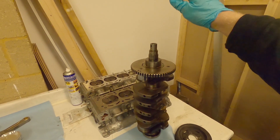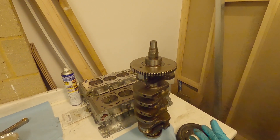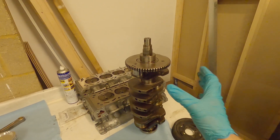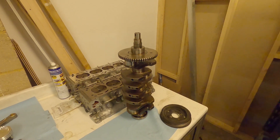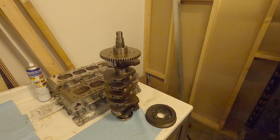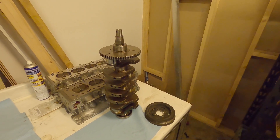The LEH also hasn't got the balancer shafts the Z20LET did, and those balancer shafts were driven by the crank in order to counteract vibration to make the engine run smoother. So there's a level of vibration that's acceptable in terms of smoothness for nice driving, but there's also a level of balance and vibration that can cause damage.